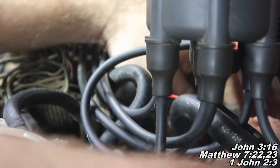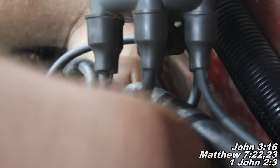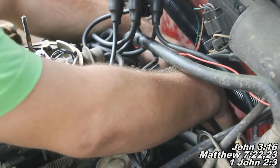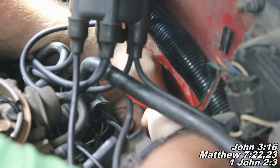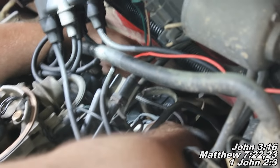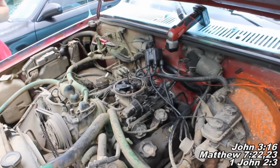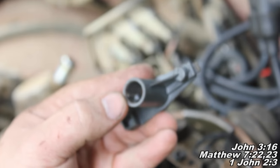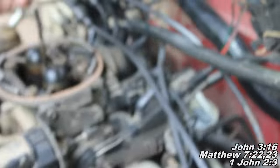As far as installing everything, it's pretty much reverse. We'll go ahead and just show you to make sure you know exactly what you're doing. We'll get the Phillips head screws started — start both screws. Once you've got both of your Phillips head screws about hand tight, go ahead and take your Phillips head screwdriver and tighten them in there tight, but not too tight — you don't want to strip those threads. It'll be hard to get out if you do that. After that, the next thing we have to do is put the rotor button back in. There's a little notch in there that lines up with the notch on the distributor — that's an important note to make.